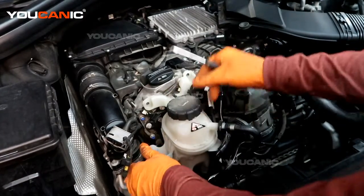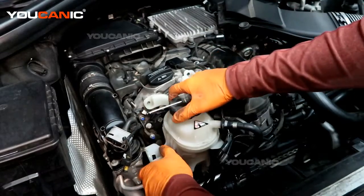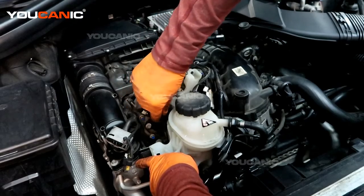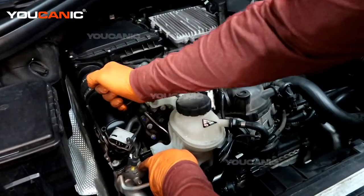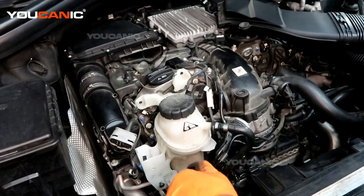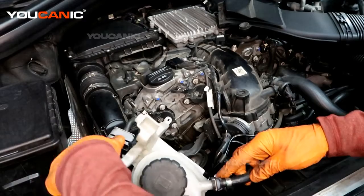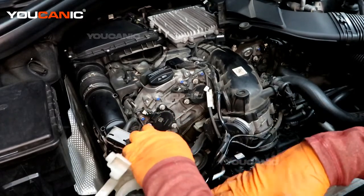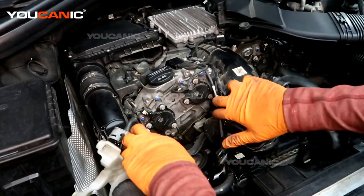With that we have access to pull this out. We're going to move this cooling line — it's an AC cooling line — and then you'll be able to pull this out. There's an electric clip holding on to this that we'll want to get off. Now we have space to move this around and out of the way, and with all that we can set this to the side. That way we have full access to these two actuators — one for the exhaust and one for the intake on bank one.